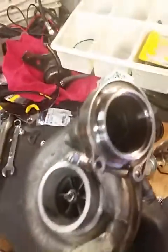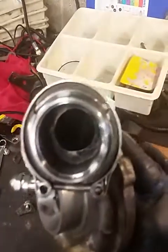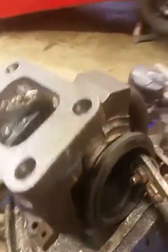Here it is on the workbench — it's proverbially dirty. Variable nozzle, oil cool only. Had to get a V-band for the outlets. And the discharge is a 3-inch as well, which I'll have to machine down flat, but it'll accept the V-band.